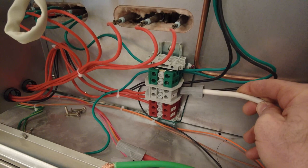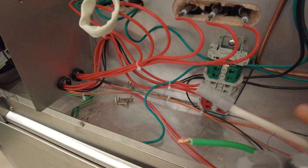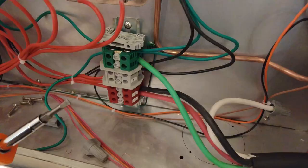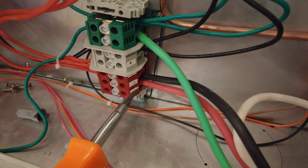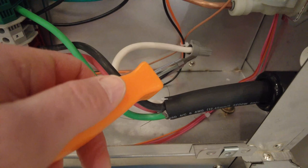I called Moffat and spoke to their technical support. Turns out the white neutral should have never been connected at all — apparently that's too hot for this oven, and unfortunately their instructions say nothing about that. The two hot wires are supposed to go to L1 and L2, the neutral should stay pigtailed off, and the ground gets connected. I went ahead and tied in the two hots on L1 and L2, with the ground in place and the neutral pigtailed. Let's turn on the power and see if it works.